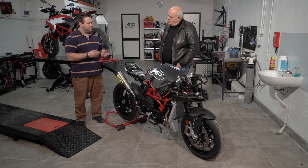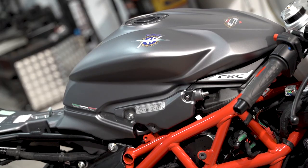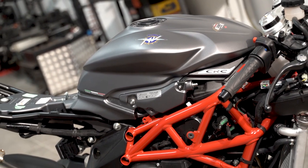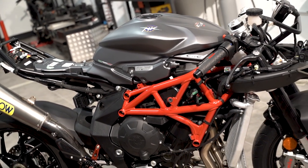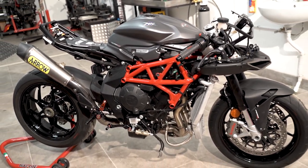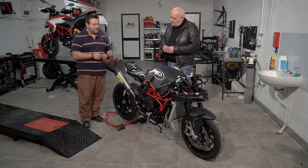We concentrated a little bit on the safety. We changed the brakes as we discussed last time and put race-orientated pads into the calipers. Using the same Brembo calipers, but choosing a pad material much more suitable for track use than for road use. Little touches like adding foam filling into the tank to stop fuel sloshing around as you go through a lot of G-forces in the corner.